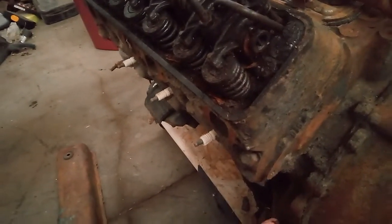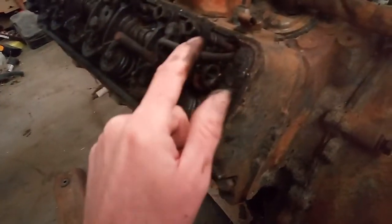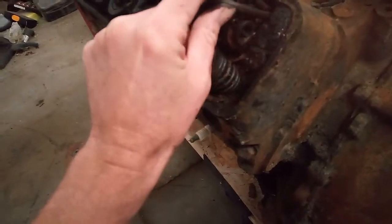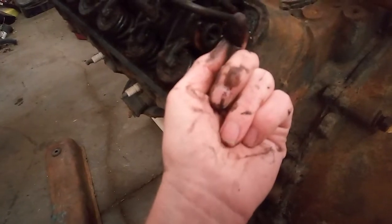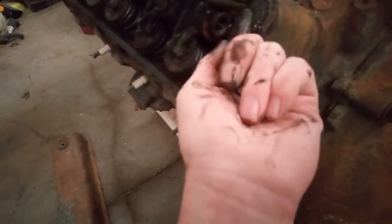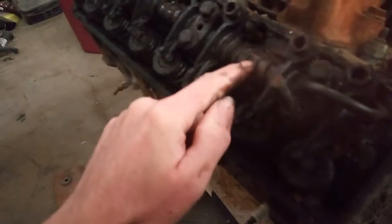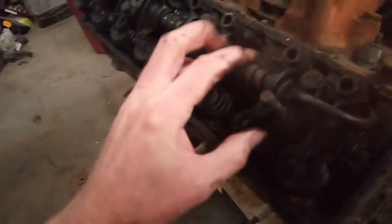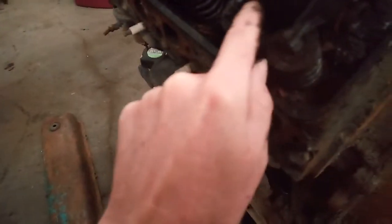So there's a bunch of tricks that guys used to do back in the day. One of them, and it's probably the one I'm going to start with, try in the beginning, is you take this and you stick a coat hanger up inside this hollow tube and you smash the hell out of it, restricting it down to help pressurize this to get more oil flowing up in here to get more to spray out these little free run holes.